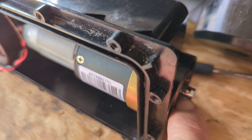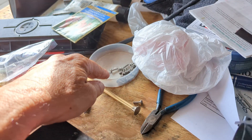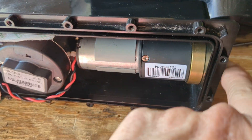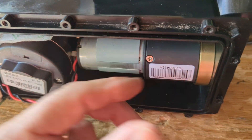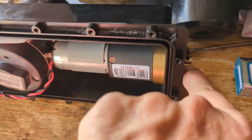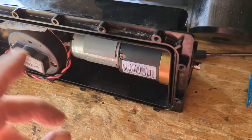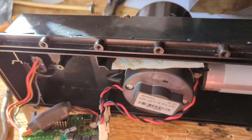Real important when you take this thing apart — very, very important — there is a pin that goes in here. Take that pin out, put it in your container. If you don't, you lose that pin, and don't lose that pin. After that, I greased the O-ring back, stuck the motor back in there — O-ring on this side, O-ring on this side. One-and-a-quarter inch Husky thin wall — works fine. If you can't find one, go to pawn shops. None of my sockets fit in there but I did go to a pawn shop and found one that worked. Thin wall will work.